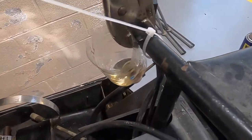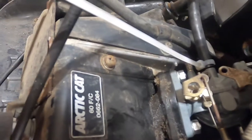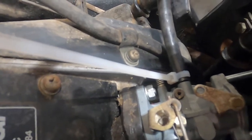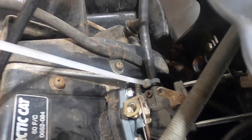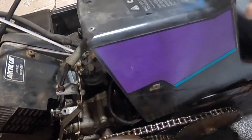We've got the hillbilly gas tank set up — it looks like the float adjustment did the trick because I don't see any fuel coming out of it now. There was some coming out of the fuel line where it went into the barb, but the zip tie is holding it just enough. I need to replace that fuel line anyway — it didn't appear to be the appropriate size. Let's give it a shot now.